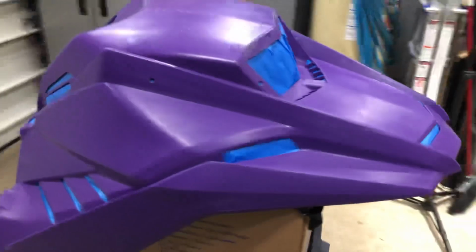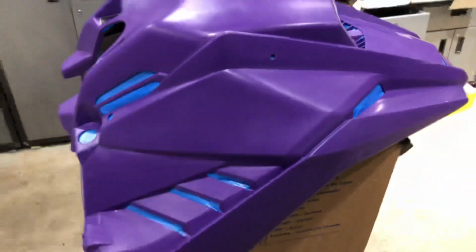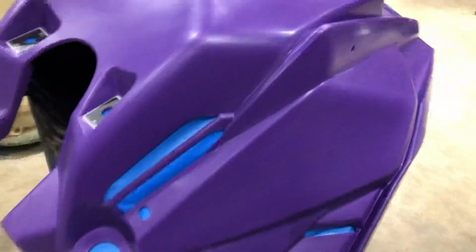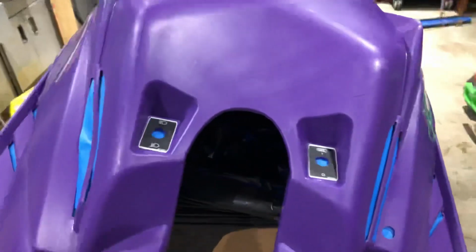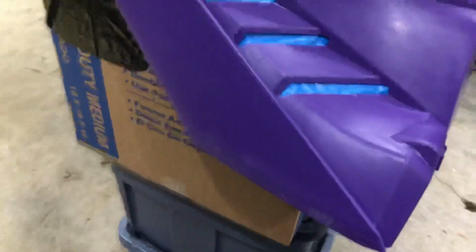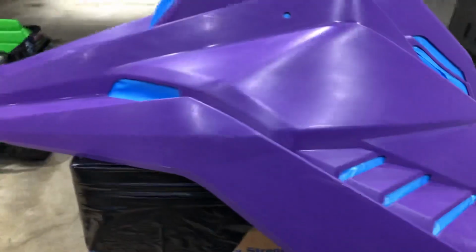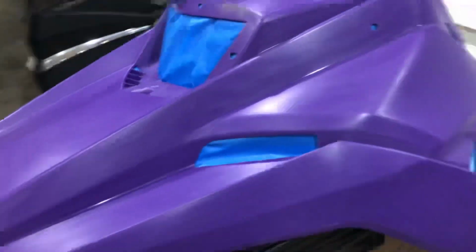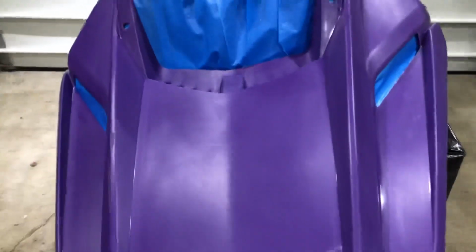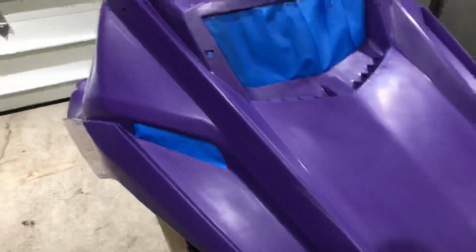The next step after that is we're gonna put on a pre-adhesion spray that I got from CarQuest. It's specially formulated to go onto plastic and serve as a primer to accept paint, to make sure that it bonds really well to the plastic. It only needs one medium thickness coat, it said. And then it says to wait 10 minutes and start putting on your actual paint coat.